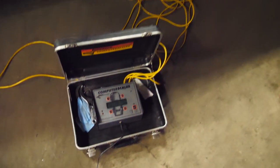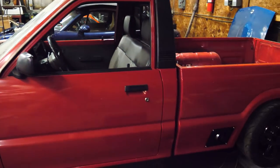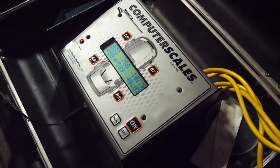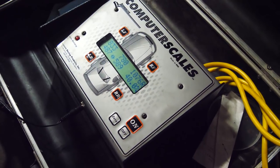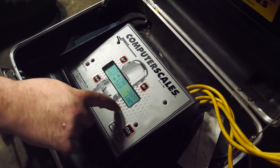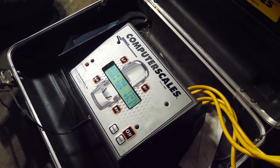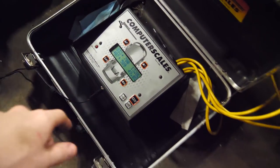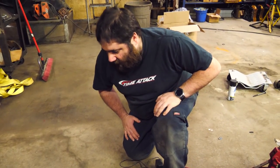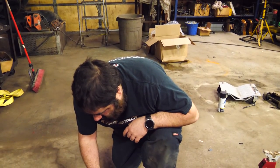That's better than I was expecting — I'm really happy with that. 2,700 pounds for a truck with a V8 and a solid axle. So how do we look at the weight balance? It's 40% rear weight — 60/40. That's not terrible; that's actually pretty good for a truck. Side weight is at 49% right now without adjusting the coilovers whatsoever. When I sit in it, it might actually balance out — sitting in it brings it to 50.6% left side weight. With a little bit of tweaking on the coilovers you could actually get this side weight to 50/50.